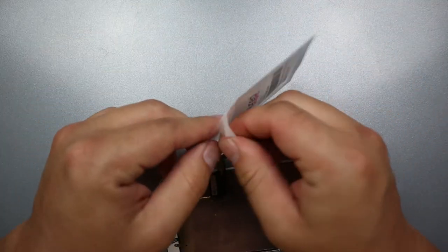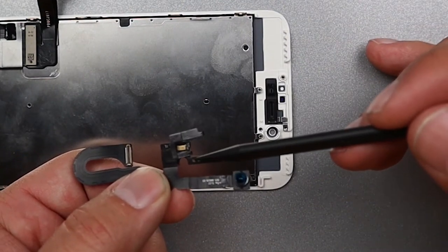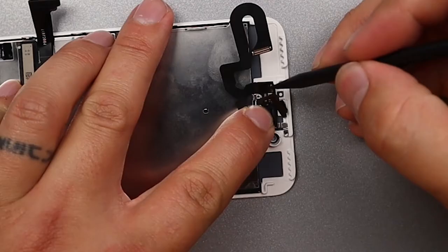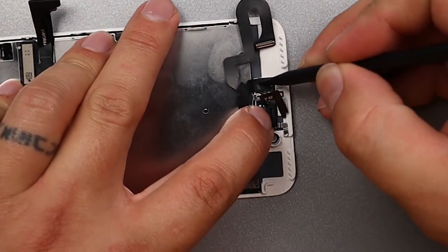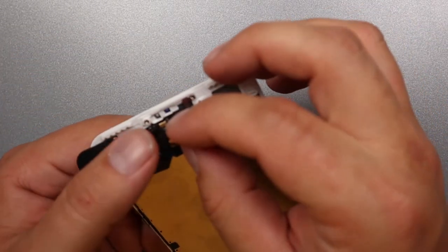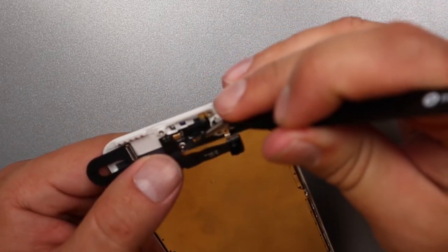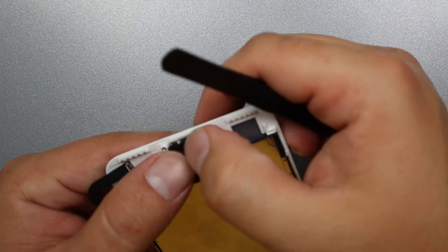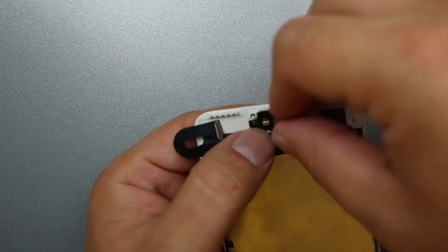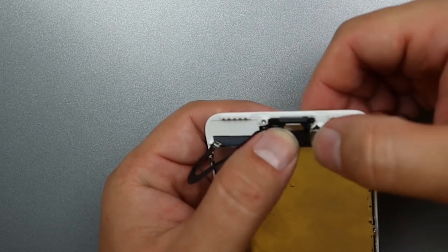The cameras are just a couple of dollars. You want to line up the two negative spaces beside the copper contacts with the two nubs on the phone. Push down the microphone onto the adhesive on the new screen. You'll fold the ribbon cable over and install your sensors into their proper locations.